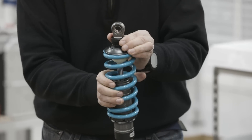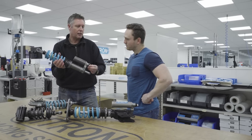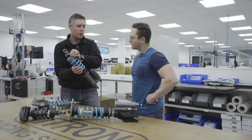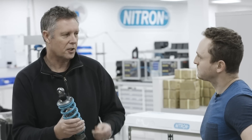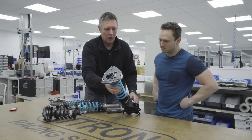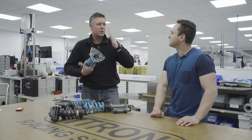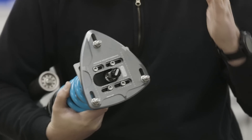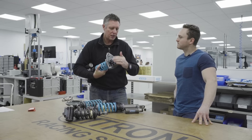With this one we've got one valve, controlled up here, which controls the flow of oil in both directions at the same time. By having the reservoir, we can put a valve in the way — one valve controls the speed that the shaft comes out, and the other controls the speed at which the shaft goes in. This is a multi-adjustable, multi-geometry capable product with camber and caster capability. You can change the camber — the way the wheel sits vertically — and the caster is the way the wheel sits back in the arch. As you turn and steer, more caster will build more camber.